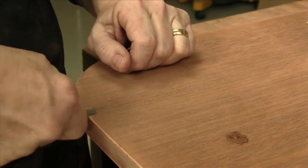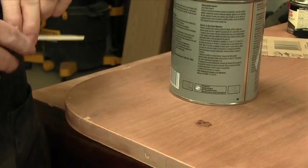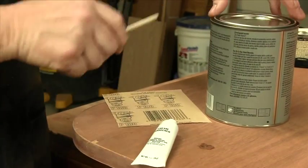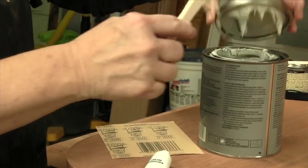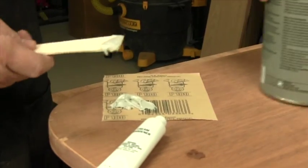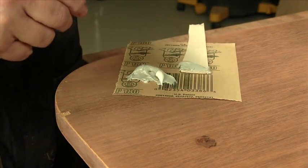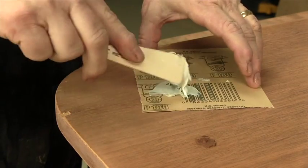Otherwise it'll just pop right out. The filler itself is going to be an auto body filler, otherwise known as a polyester. It has a little tube of hardener that goes with it, and we're going to use a little piece of sandpaper as our mixing palette. We don't need very much — just take a small amount out. The trick is to make sure you don't use a pile of hardener. That's really as much as you need. More hardener does not mean harder — it actually messes up the hardening of the putty.